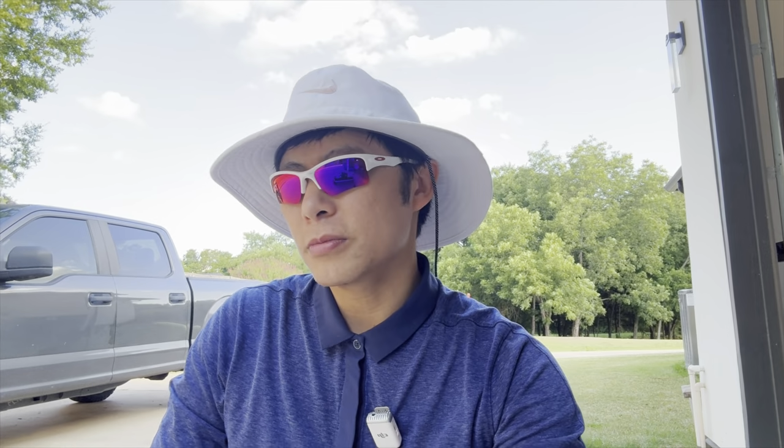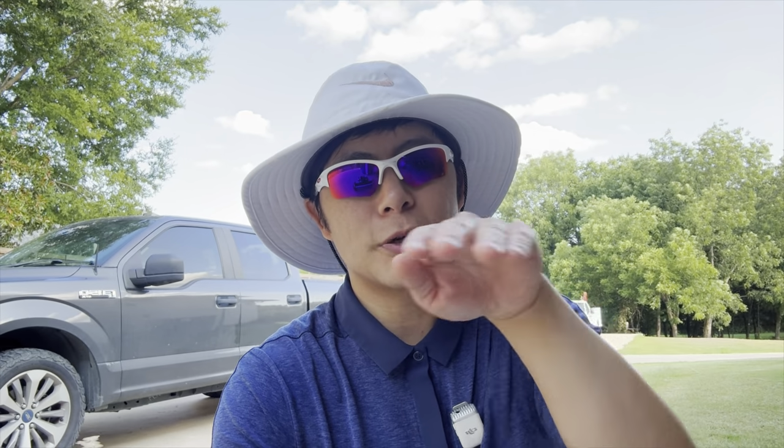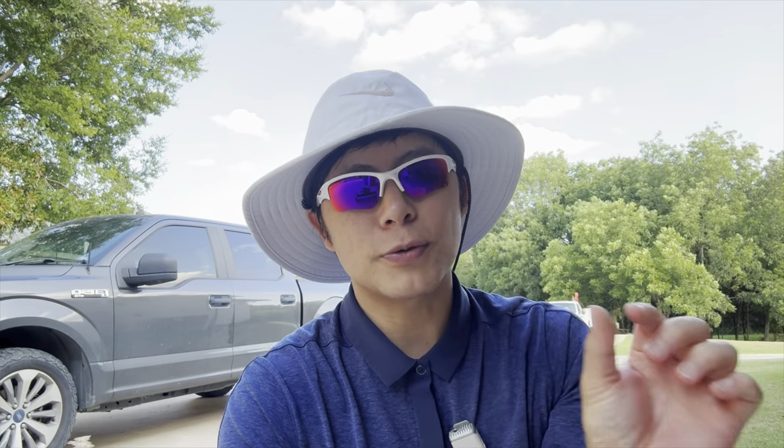Alright guys, I just got back from getting my mower sharpened, and I learned a whole bunch of things from the mechanic. Essentially, my bed knife is warped, so it's kind of a U-shape or upside down U-shape. So that's why the ends weren't cutting, but the middle is cutting perfectly fine. He told me it's kind of a notorious thing that Toro does when you buy bed knives. They don't come quite flat, so they have to grind all that out.